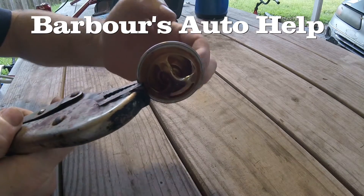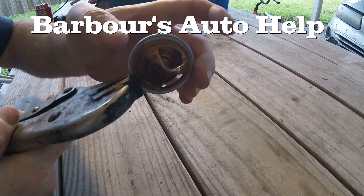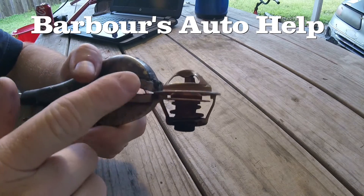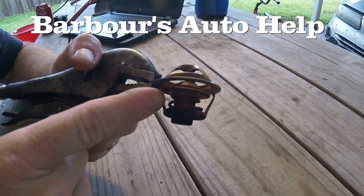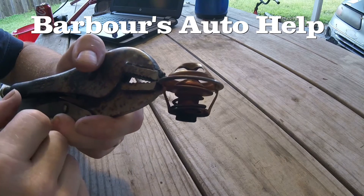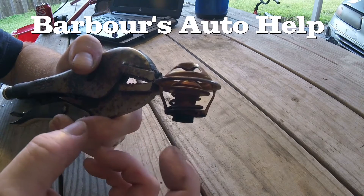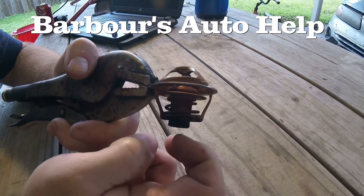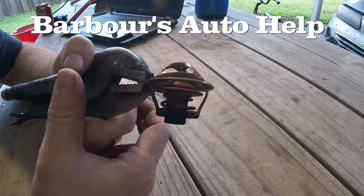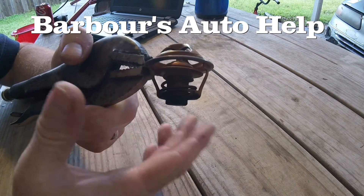Now we're near about fully open. You can see there's a big area that the coolant can flow past the valve and the flange. What's going on is that piston is overcoming the force of that spring and allowing that valve to open up. As the coolant cools down, the heat motor will start to contract — the wax inside will start to contract — and the spring will push the valve back up to the flange and slow down the flow of coolant, trying to keep it at that optimal temperature.